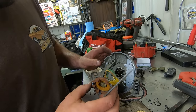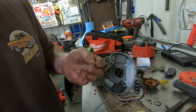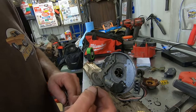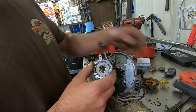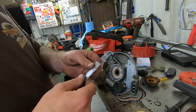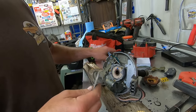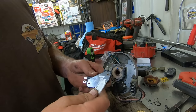Now, what just went click? Some type of acorn or something. Mice, Duff. So now we just slide this one in there. It's only got 2 wires instead of 3. Slide her up on her vacuum advance. Put some, I don't know, heat conductor lube, whatever, because lube is good.